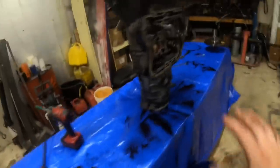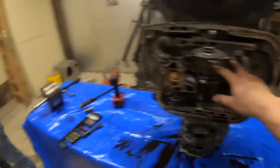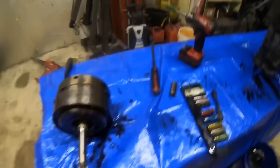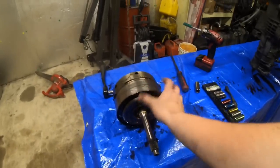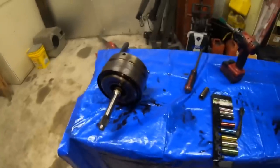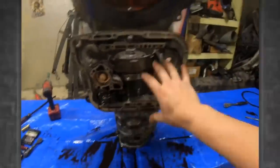We're gonna assess all the other damage on the clutches and everything. But that's definitely what the issue was. These two were welded together. So whenever you went to start the truck, the converter was basically trying to drive the truck even in park. So now we just have to get this apart, re-inspect everything, replace what needs replaced, and we're gonna put the new valve body in and clean it all up while it's out.